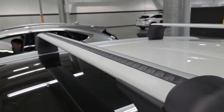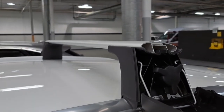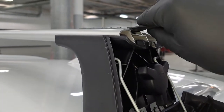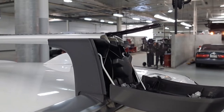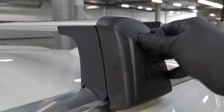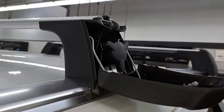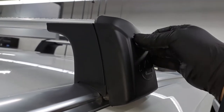Front is done. Now put on the rear weather strip — so much easier once you lube it up. This one has a lot left over so go ahead and cut it. Once you cut it, install your covers — bottom first, push up the top, lock it up, and remove the key. Keep it somewhere safe. Hook on the bottom piece of the cover, push the top, and lock it up.